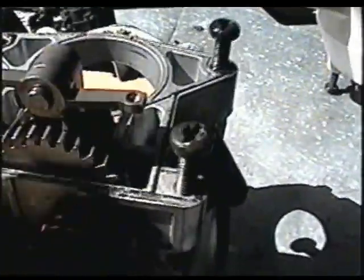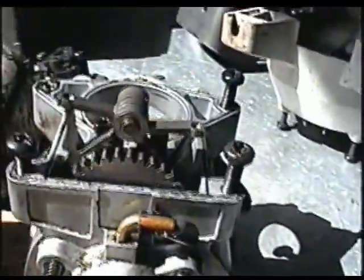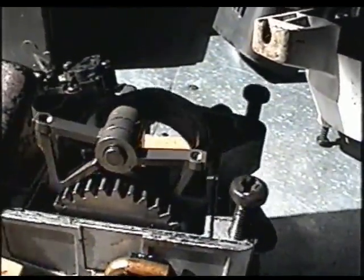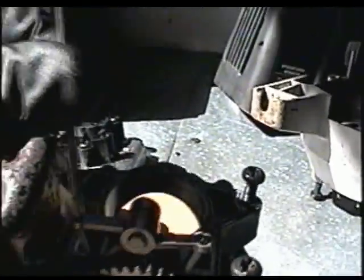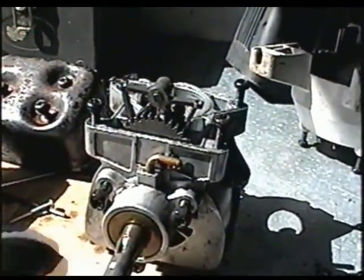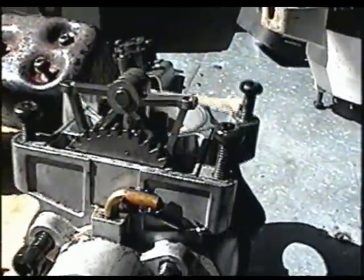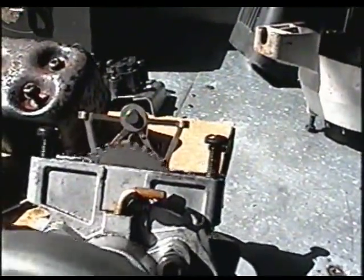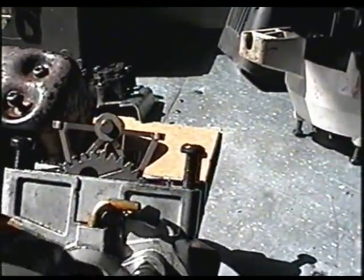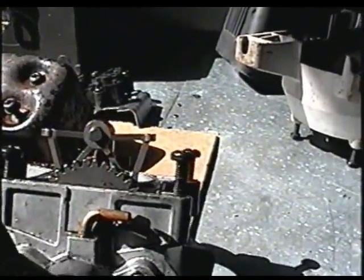Here's how it works. That's the camshaft right here and it opens these up. The push rods sit right on top in the grooves like this in the motor. There's two of them and when the motor turns these little arms turn as well. You can see them moving up and down — that's what opens and closes the valves.